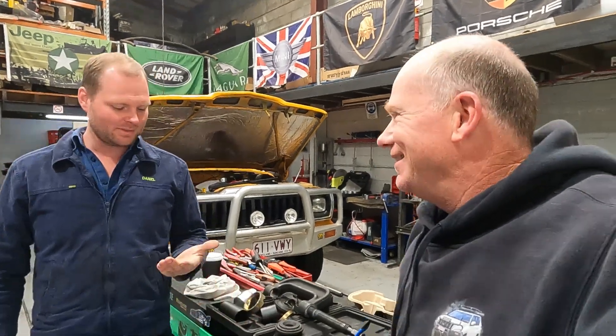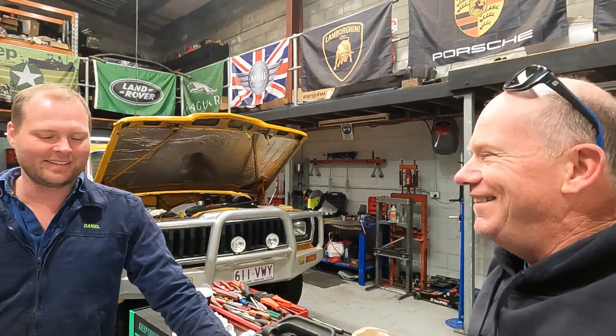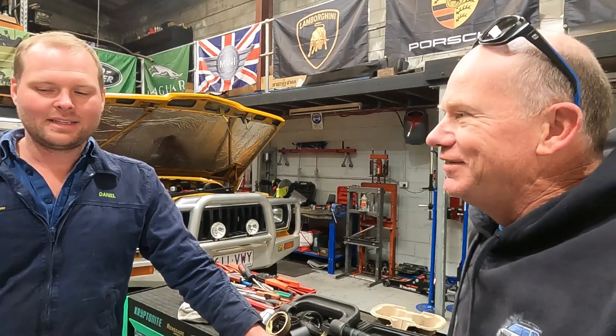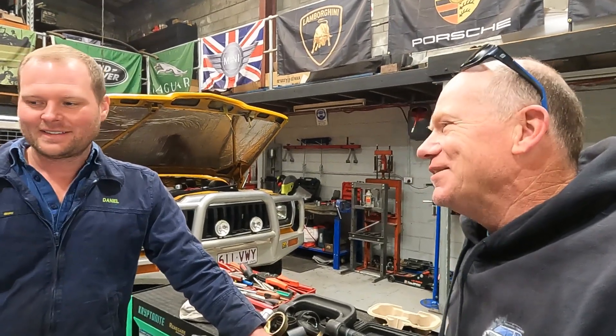So we're going to finally come to the end of this saga - the steering side of things. We've had troubles with alignments and things not quite adding up, and it looks like potentially there's more bent inside of there, so we're just going to admit defeat and actually replace the lower arms now as well. I reckon you'll get me on the tools today mate? I've seen this job done a number of times now back and forth. This is quite straightforward, it's pretty easy. Maybe I can do one side of it. The only thing that will catch us is if the eccentric bolts are seized. We know what we've seen a few of them on this car so far. I'm going to say that there will be. So I've got new ones here - no matter what happens, new ones are going in. There's always a grinder to cut them out.